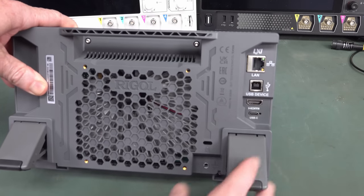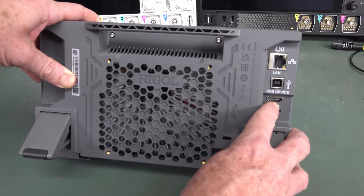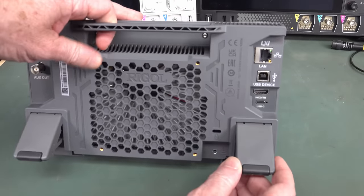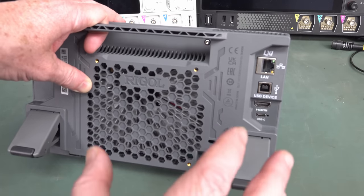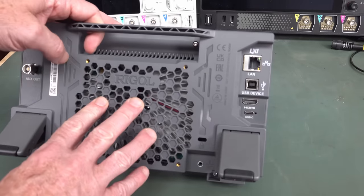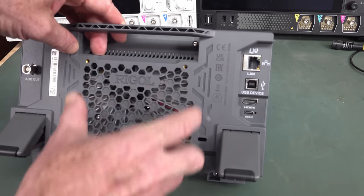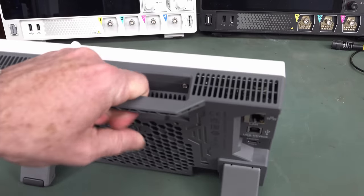It's got the VESA mount, USB-C power, HDMI output — I've just been experimenting with that today. It seems to render at a higher resolution than the built-in 7-inch touchscreen, which is 1024 by 600. It seems to output at the native resolution of your monitor, but I don't think at this stage you actually get increased bits. It does look really good. LAN and USB are all standard. It's got a fan in it which is kind of whiny and high-pitched, as you'd expect.